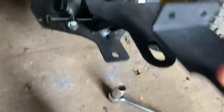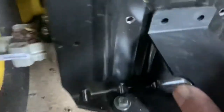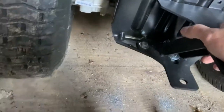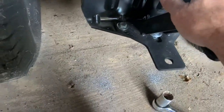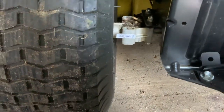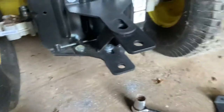On the top, what happened was they give you two different plates. I said, I'll put them both on. The problem is with the John Deere tractor you have these ribs, so the skinny plate lands at a slight angle. I said, that's not going to be a nice firm surface, so I'm going to put just the flat plate here. I'm taking this apart — I'm going to spray some rust preventative in there. So I put the top bolts there, and I'm trying to catch this with one hand while filming. I put my top bolts in, and then you put the hitch right through here and it holds it in place — and that's what it comes out like.